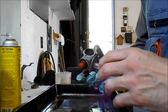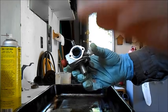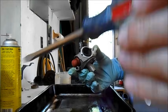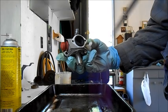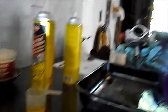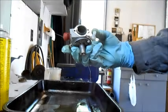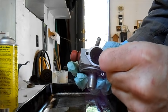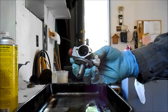I've looked in every passageway on this carburetor and everything seems clean. So I took the intake that holds the air cleaner off, and I took my screwdriver and tapped the emulsion tube down. We're going to take the emulsion tube out. I have an Allen key in my little carburetor kit that I use specifically for this, and I push down the emulsion tube.